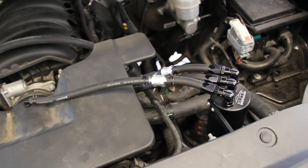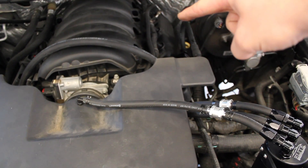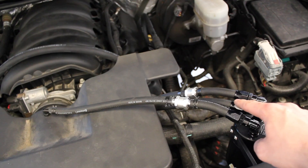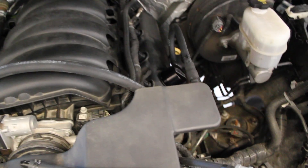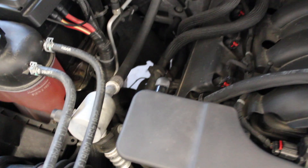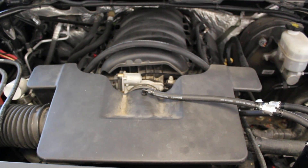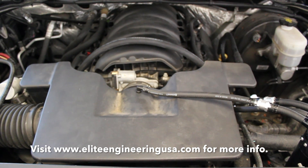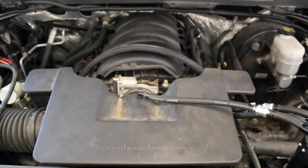To recap: we have two exit ports — one going to the connection on the middle of the intake manifold, and the other going to the hole we drilled in the intake tube. We have a single input coming from underneath the throttle body, which is the crankcase vent. We have our clean side separator connected to one side of the intake tube, and the other side of the intake tube is completely blocked off. Not too hard! Once again I'd like to thank Elite Engineering for providing the materials. Visit them at eliteengineeringusa.com, and thanks for watching — please subscribe.